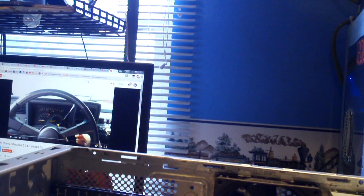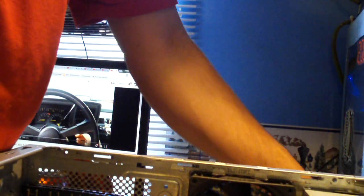So I'm going to unplug it. Interesting - now all standby is dead. Let's unplug the motherboard connections and manually try to start this power supply. The remaining hardware is still plugged up, so if the power supply does turn on you'll hear the hard drive and things like that spin up.